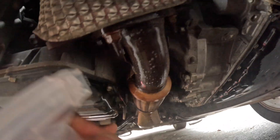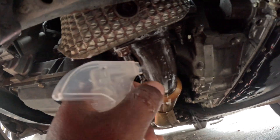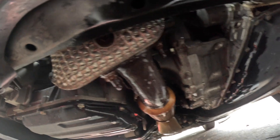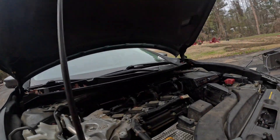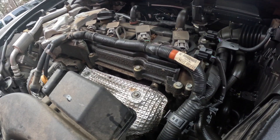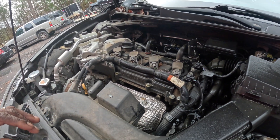All right, so this is where the cat is meeting the exhaust. Still no leaks. So that lets us know that this car does not have an exhaust leak anywhere. One thing I can do is remove this cover and you'll see the cat itself and can spray in there, but since I know if that was the case a code would pop. So there's no use taking all this loose because that's not the issue. It must be something else — it's a faint little sound, but I just want to figure out what it is.